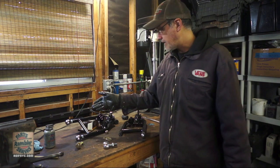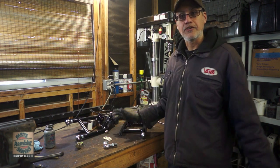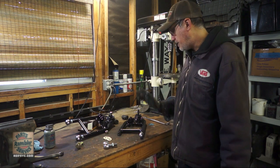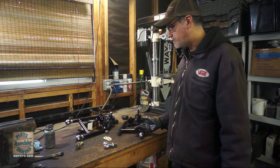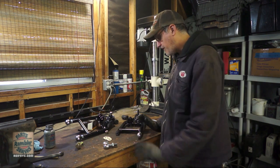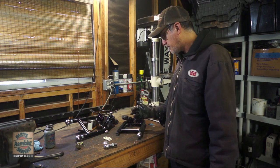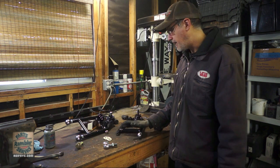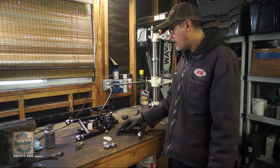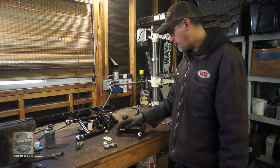Then I had to do the same thing on the driver's side, except this time on the first cut I cut it to where I had cut the passenger side. Put it all back together, saw where it was, and it wasn't quite right, so I had to pull it out a second time and trim about a tenth off. Then put it all back together — that's tack welding every time, then cutting the tack welds and trimming on my bandsaw when I needed another trim. Anyway, I finally got it to where I liked it, took the whole thing apart again, and took it over to Joe, a chassis builder nearby, and had him TIG weld the bungs in like Alec told me to do. Then last night I rattled them with some black spray paint again since they'd gotten chewed up from all the in and out.